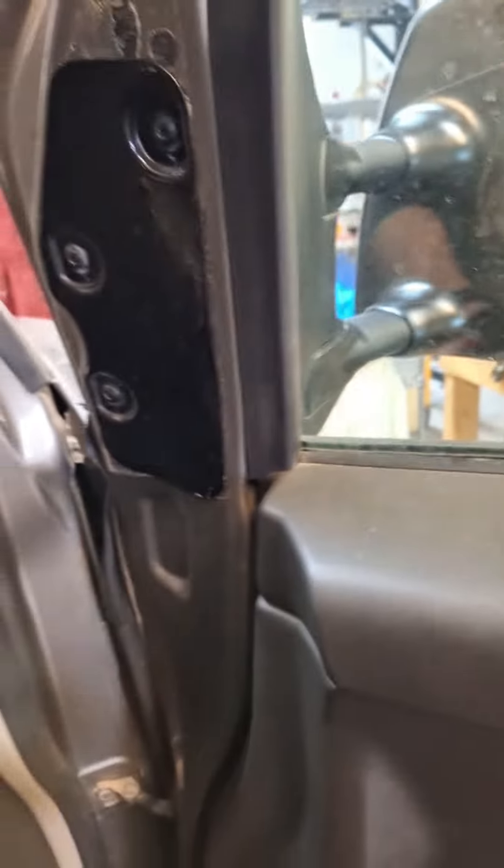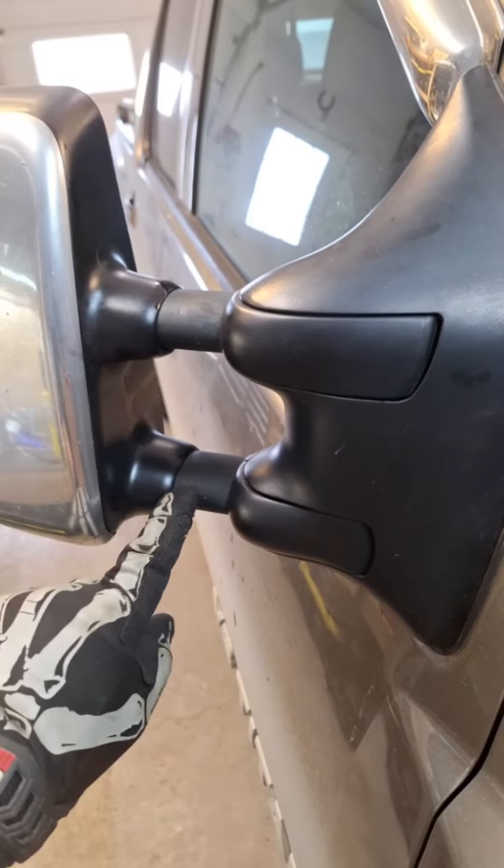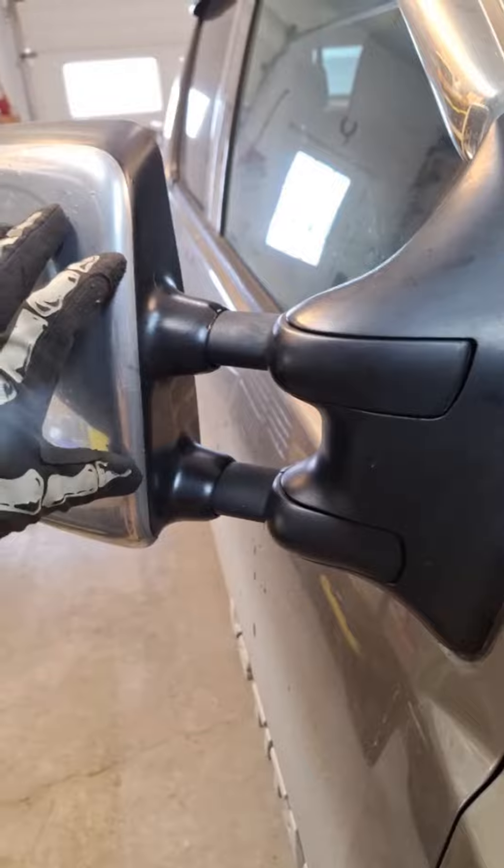Since I don't have wiring to deal with, I stuffed it in the hole in the door and it just dangles there. Once you've done that, the last thing to do is spray some WD-40 or Liquid Wrench in here — this is going to make it a lot easier to slide the mirror in and out by hand when you need to.